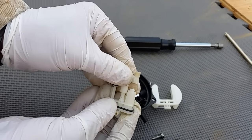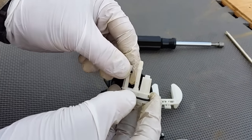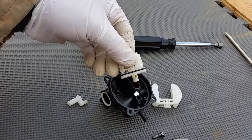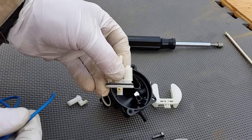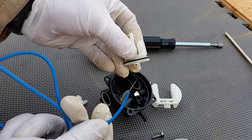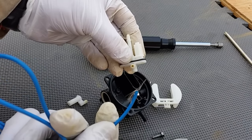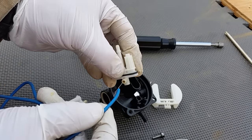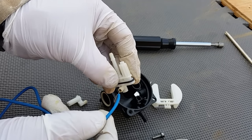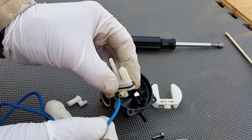That's the trick to get these pieces apart. Make sure your o-rings aren't bad. Then you've got to get something real small to clean out these two ports — here's one. I took braided wire because I didn't have my welding tip cleaner around, so I wound together a few strands to the right size, then poke it in there and get the debris out. That gives you a nice way to clean and ream out any debris on the sides.